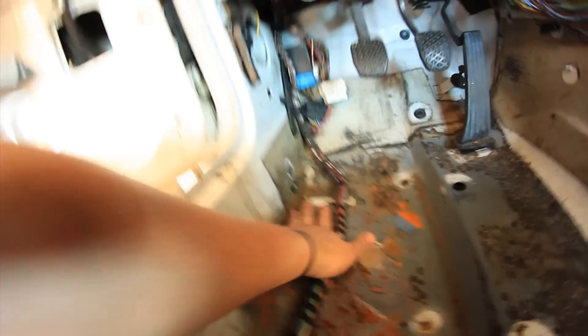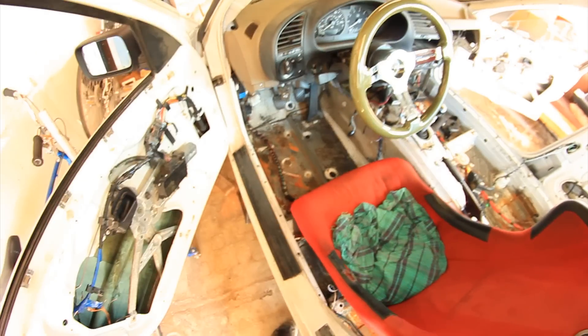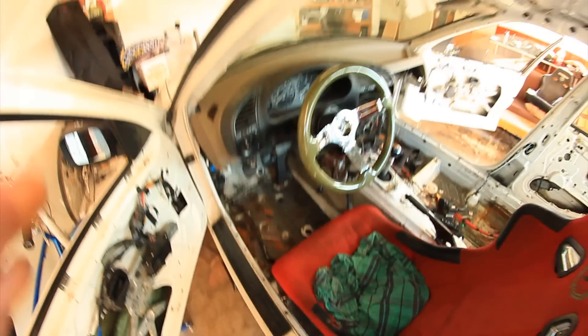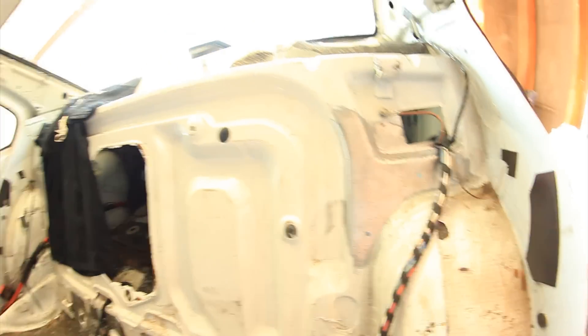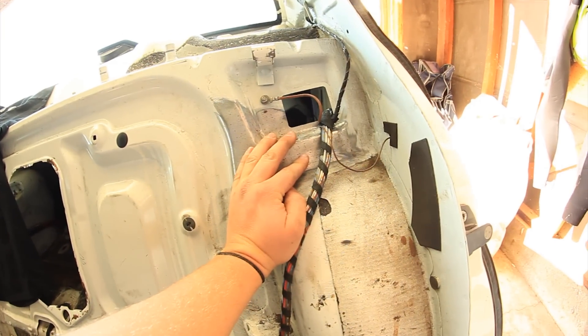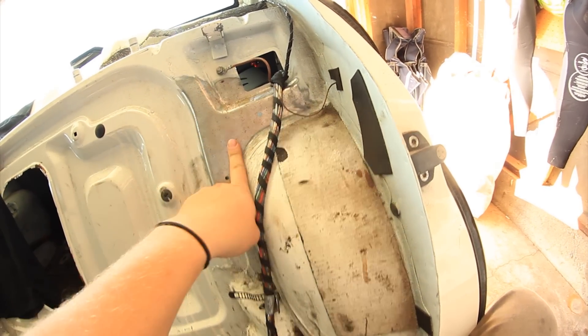I got my other plates getting ready to put up here and I already cut and measured everything pretty much. I already bent my main hoop. I got my door bars bent and cut to the right length — well, I made them actually long so I can kind of cut them in place. And then I got my down bars which are going right here. For the four doors, my buddy has one here and it passes tech, so I just decided that's where I wanted to go. I still have to make the plate that fits right there.